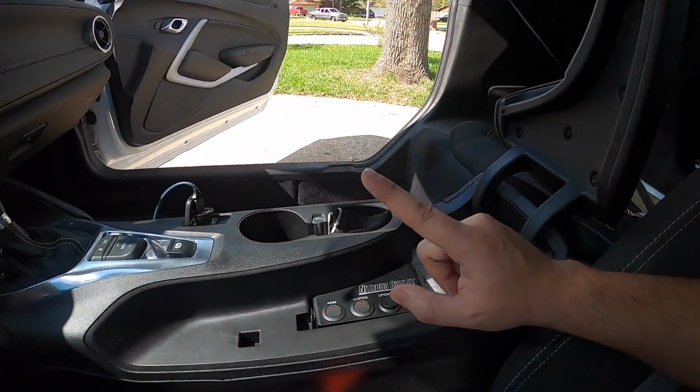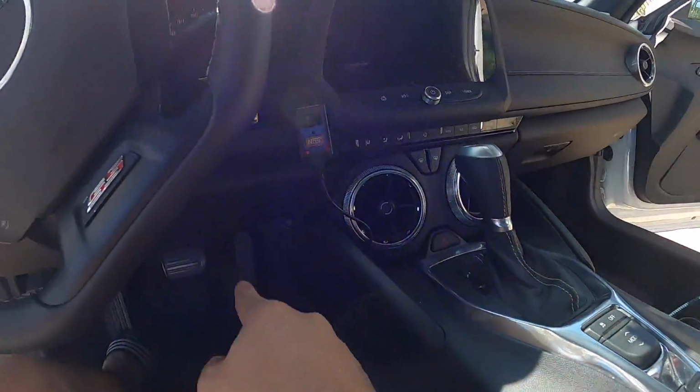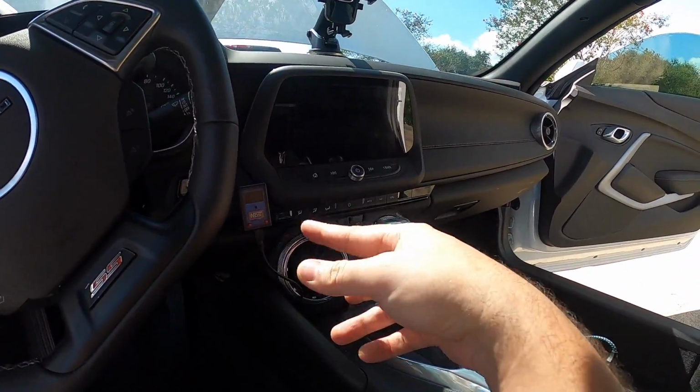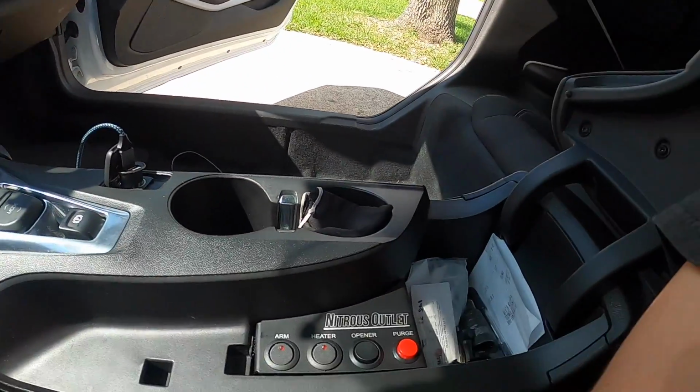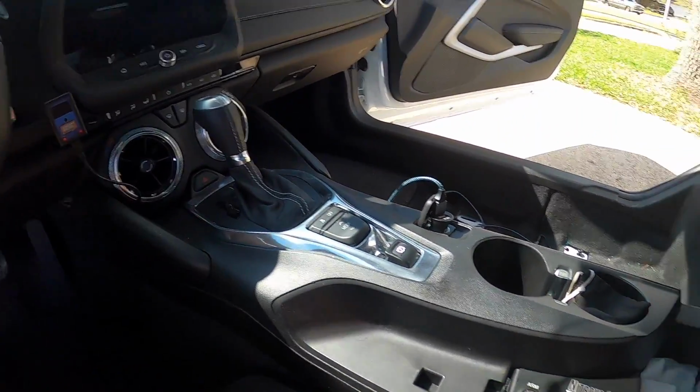So we already cut a wire there. I found the power wire under the dash for the gauges, so we just gotta cut that, splice them together, and then test to make sure that everything is still getting power where it needs to get it. And hopefully that'll take care of our nitrous fuse blowing issue, and we can go out and have a good time when we're running these cars. But anyways, let's get back to some of the runs, guys.